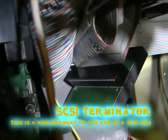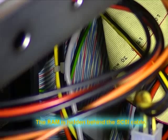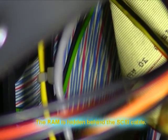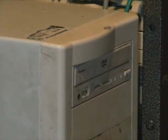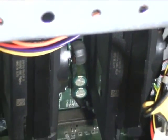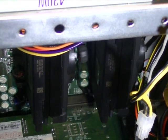The machine has 2GB of 100MHz SDRAM installed somewhere behind that drive caddy. The original RAM was ECC but eventually it failed, so I'm now using non-ECC, though the performance difference is marginal at best. Think about that — you are looking at an x86 computer from the 1990s that has to measure its memory capacity in gigabytes. That there is a Pentium 3 Katmai processor at 500MHz on a 100MHz bus — stepping SL37D. And here's the system's party trick: it has two processors. What is interesting is that what's happening in here is closer to modern dual-core Intel CPUs than the Pentium D in my current workstation.